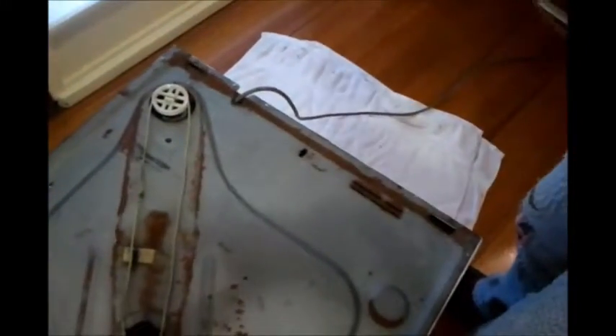This belt had broken, which goes on there and drives the motor pulley, and it drives the little blade fan to circulate the hot air, warm air, or cold air. What's this made from? Just plastic. Obviously the heat makes them brittle.